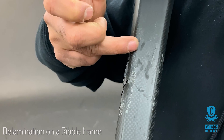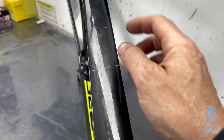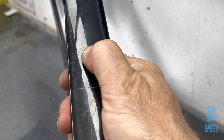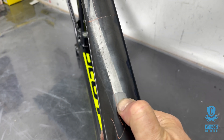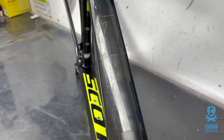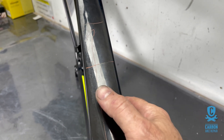In many cases you can get crack lines in your top tube, so it's not always the case that you won't see fracturing of the paintwork or lacquer. In this particular case what was harder for us to find was that there was no mark on the top tube at all — it just took some diligence. Compress it in these areas and it's nice and firm, but here you can see my hand starting to really bulge, particularly there, and then go stiff again. If it feels incredibly soft or leaves a line in the surface, it's probably broken along that mold joint.